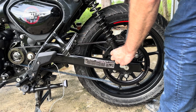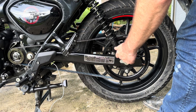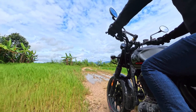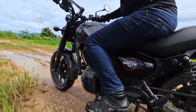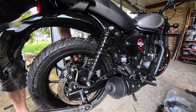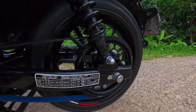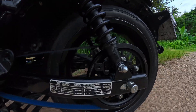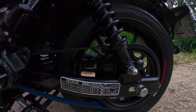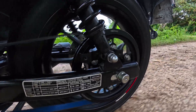Just popping the suspension back in, remembering it's going to be 45Nm of torque when we tighten it back up. This can be a fiddly process and might take some time to get right, but proper alignment and tension are crucial for the longevity of your belt. Once you're satisfied, torque the rear axle to 70Nm, run the bike on the centre stand and double-check everything. Don't forget to tighten the belt tensioner lock so the hex keys don't fall out — that's a common user error. I'll check the tension again after a short ride and give it a quick visual inspection every 4000km.